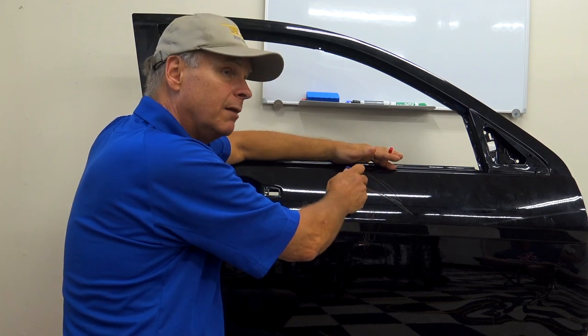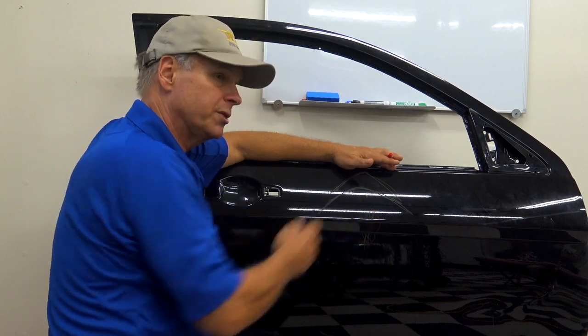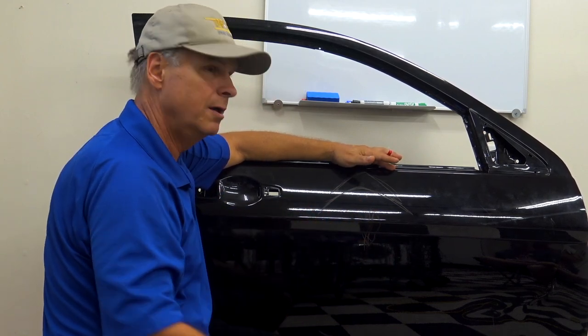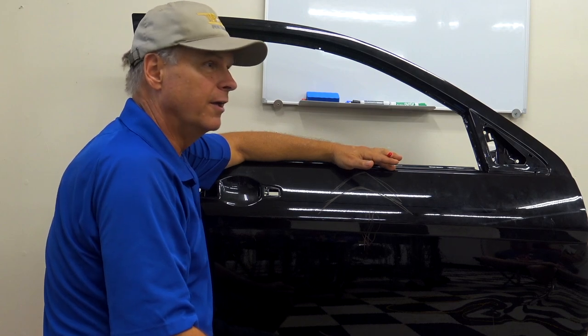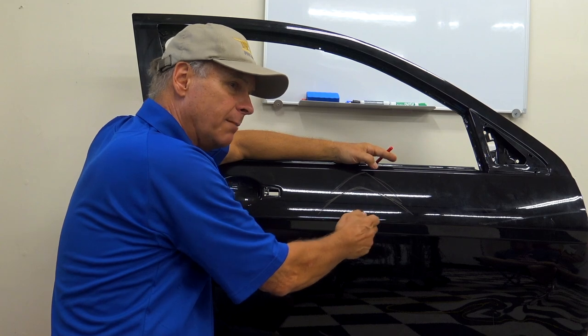You say, well, do you ever put any more pressure on the body line? It depends on how my crown is moving, guys. You'll notice a focus here. Everybody's focused on the body line. A Fairmount Method metal guy, that was, whew. Nobody would even think of doing that, because we want that energy back into that body line first.